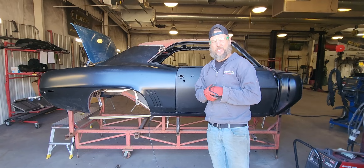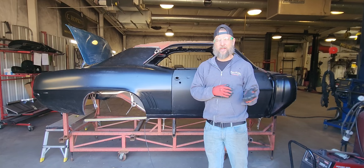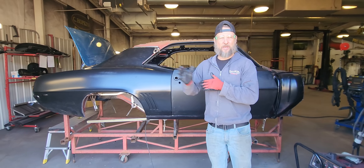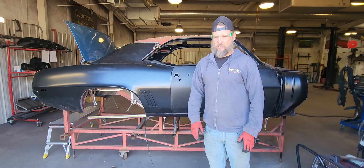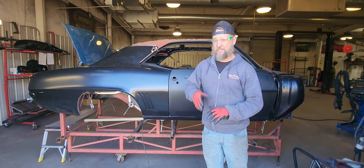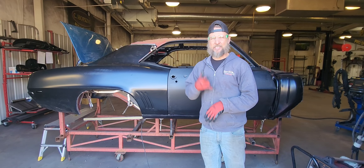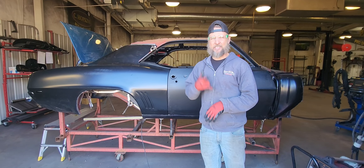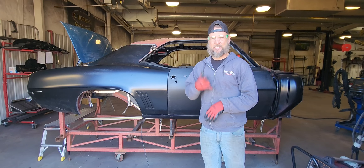Let's see what the other side looks like — it was the same, we just didn't ever get a comparison. This side over here, the lighting is not as good, that's why I didn't come on this side. But that gap looks nice. The gap's good, and my door is a little bit back on my rocker — you can see, it's a little bit back. So if my door is centered, like I always tell everybody to do, now I've got adjustment to move my door forward just a little bit, even it up right there, and that's going to make that gap perfect.